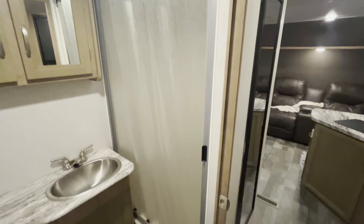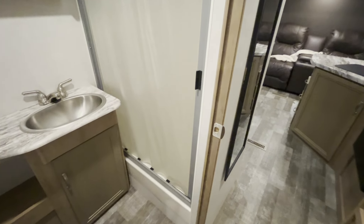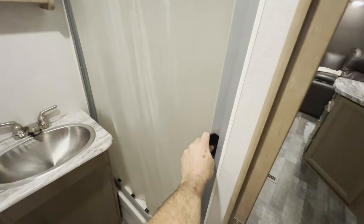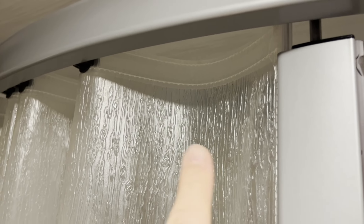This thing actually has a pretty ingenious design. It's attached at both top and bottom and sealed to the sides, and it opens much like a shower door. When they're new, they're nice and clear like this still is up top, but as you get older they get soap scum on them and need to be changed out. Also, due to somewhat of a design flaw, there's a place that this catches water and molds pretty bad, right there at the bottom.